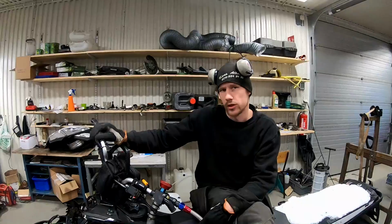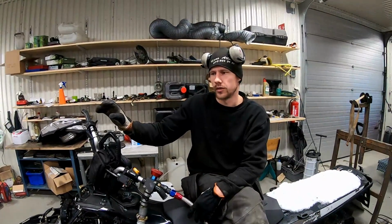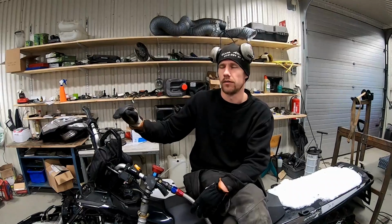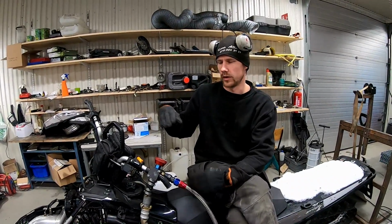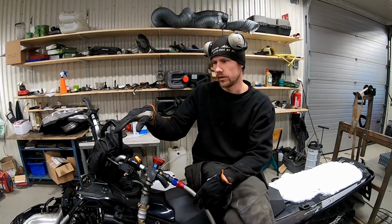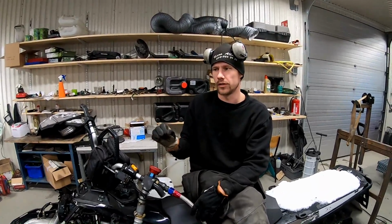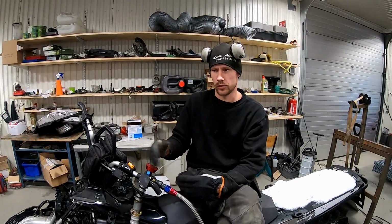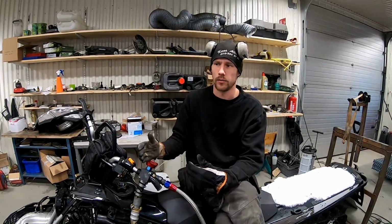Now we're going to be running with a shortened pipe, and I raised the ignition also 1 degree, so it's 2.5 degrees above original timing. That's because when the RPM goes up, the original curve goes down. At 7900 RPM we have 13 degrees standard ignition, but at 8000 we only have 12, and at 8100 we only have 9 degrees. So we're going to aim for 8000 RPMs.